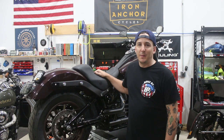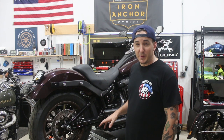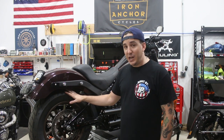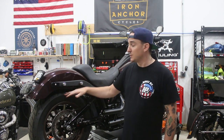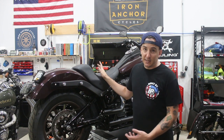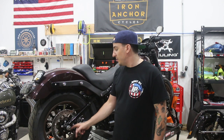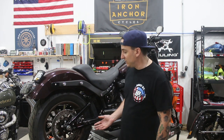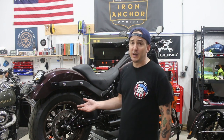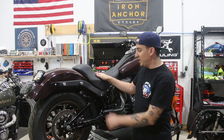That wraps up our install of the RWD RS1 MonoShock for our Lowrider S. One other thing worth pointing out: you can see we've got the mufflers removed on the bike now. Since the ride height of the bike has changed fairly dramatically — hopefully you can see there's a much bigger fender gap here than before — because of that change in ride height, you are going to most likely need to adjust your rear belt tension. Ours was pretty loose when we got done, which makes sense given the new geometry. Depending on your bike, you may or may not need to remove one or both mufflers to get access to both your axle nut and the adjusters. On the Lowrider S, just taking off the bottom muffler gets you access to the axle nut, but to get access to the adjuster bolt the top muffler has to come off too — which is no big deal on a new bike; it's a few bolts that just slide right off. We've got our tension readjusted; we just need to put the mufflers back on.